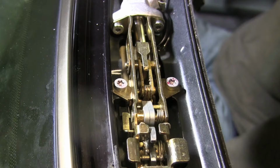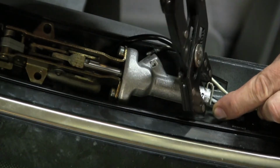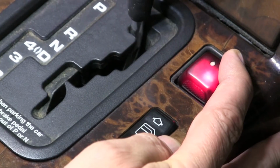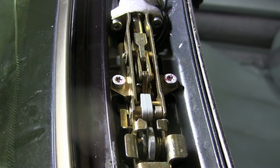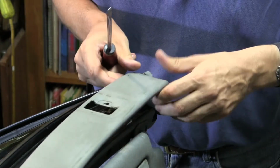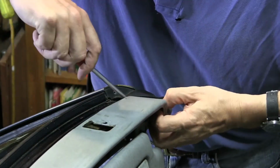On the driver's side, however, notice in the upper right, one of the steel lines is loose. So I'm back with the pliers to reseat all 4 lines on both sides. Once we're confident that the latch mechanism can move without the hydraulic ram or lines leaking, we can put the header bar cover back on the top of the windshield.